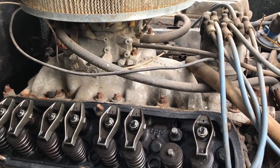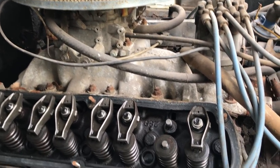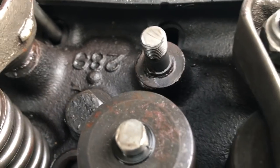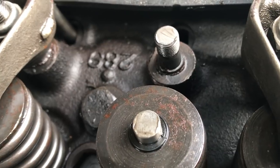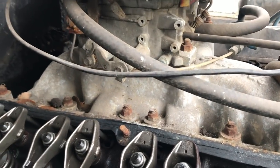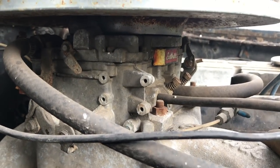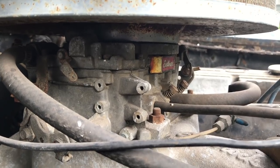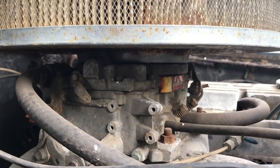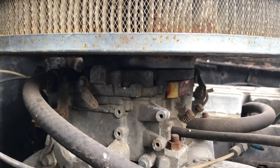I want to replace that one, and eventually change all the roller rockers, but right now I just want to get it started and go from there. Looks like they've already been changed — I think those are screw-in studs, not press-in ones — so we'll see if we can get that stud out. If we can, we'll get a new stud, a new rocker arm, a new push rod, and put it all back together. I got the rebuild kit for the carb. This is the Edelbrock — the carb I'm most familiar with. I've learned how to rebuild these first and have never really worked on Holleys, so this is the one I love, and I've got the kit for it.